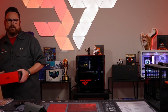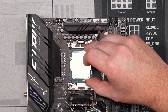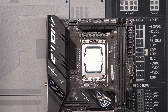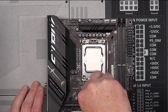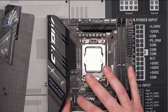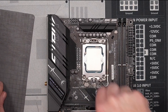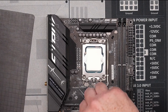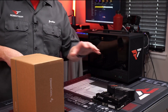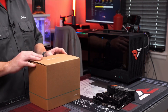Let's jump into getting the build going. Let me go get my CPU — it's going to be a lot of fun. Let's put our M.2 in. We're not going to put the air cooler on first; usually I will put the air cooler on and then install it, but we're going to get the GPU and some other things in first. There's a little bit of an order of operations on this one.